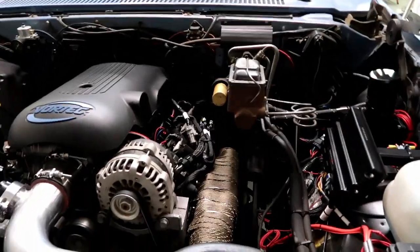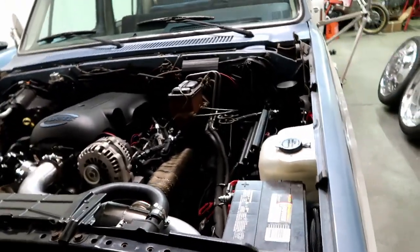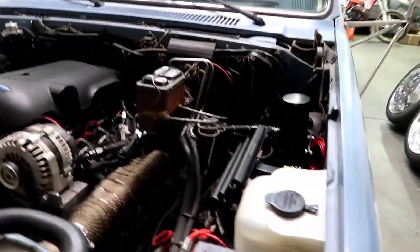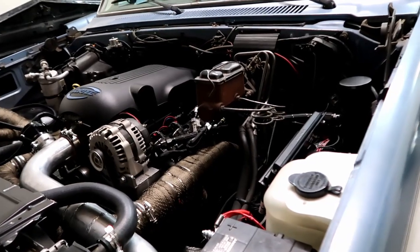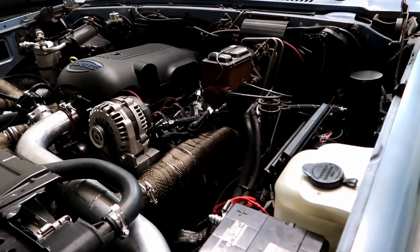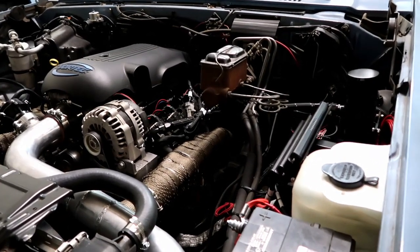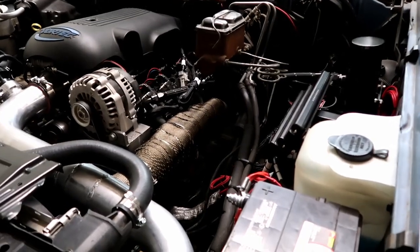So that was interesting. And then you have to find your power off the little fuse block under the dash and make sure you got switched power, and switched power when it's cranking, and there's quite a bit to it. So it's good to have a handy multimeter and some basic knowledge of electrical stuff. That went a long way. Or find a friend who does and they can help you out. But that's pretty much it in a nutshell for the wiring.